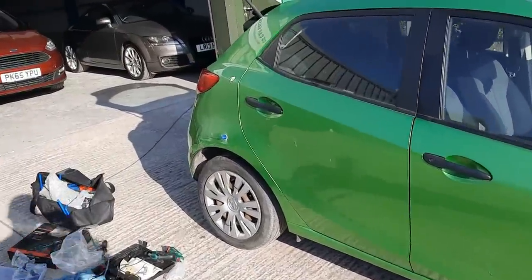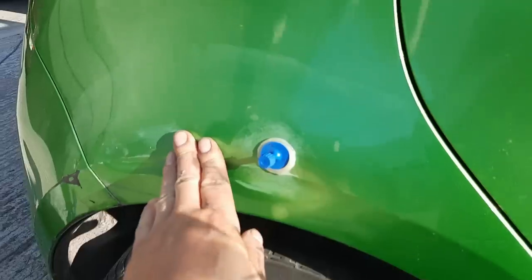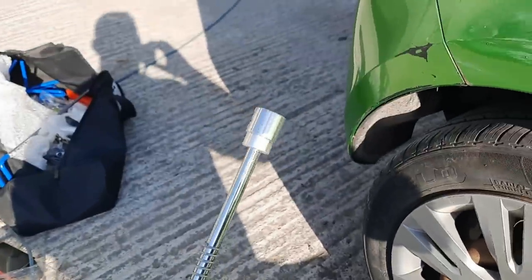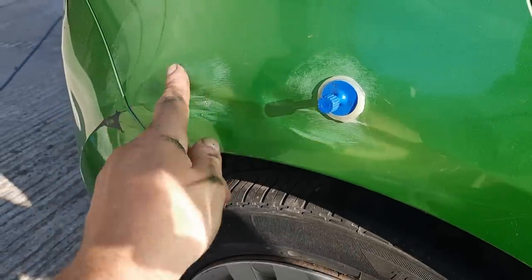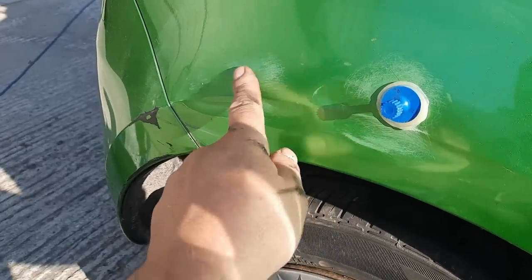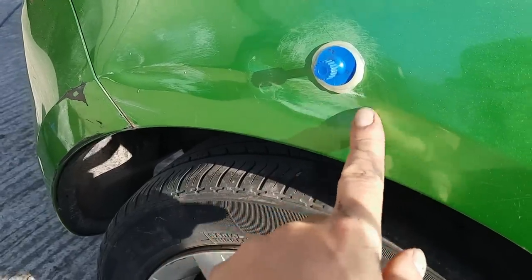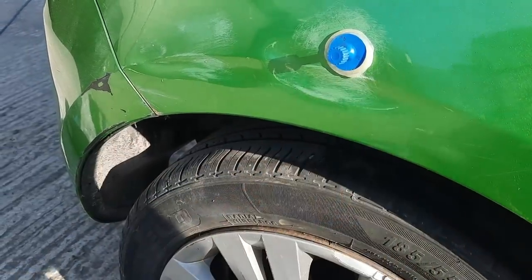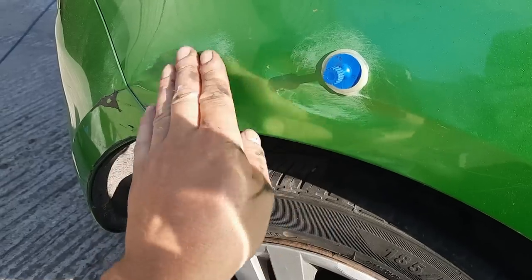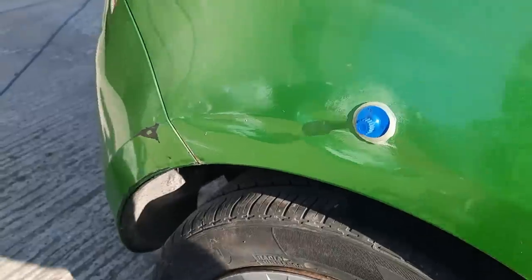We're painting the rear quarter and it had some big dents. I didn't want Davy to fill those dents with filler, so I've got out my glue gun and puller kit. I've actually managed to pretty much get those deep dents out. These very tight ones - I don't think the glue pull is going to work because it's too tight - but that means those are the only little areas we're going to have to get filler in. It'll need the lightest of skims but I've taken out all those deep dents.